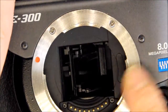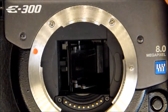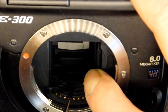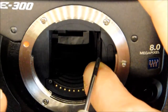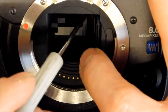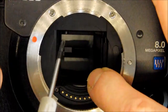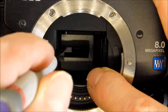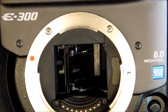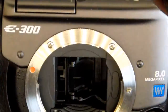It means we must have a whole bunch of mirrors driving the light to the optical viewfinder. The autofocus sensor is located at the bottom, as usual, but you cannot have it the usual way — normally there is a small mirror behind the main mirror which flips out of the way when you take the photo. Here it is located at the back and it is a moving part which goes to the bottom when you shoot a photo.